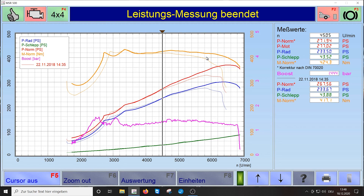The engine code most affected and very famous for this issue is the BHZ engine code from the 2-liter TFSI, first installed in the Audi S3 and also in the Seat Supercopa race car and the Volkswagen Scirocco — they all had the BHZ engine with this issue. The CDL engine which came later I would also recommend changing the springs already from around 400 horsepower, because as you can see on the dyno the drop comes very gradually and you don't feel it, but you will see it in the power figures.